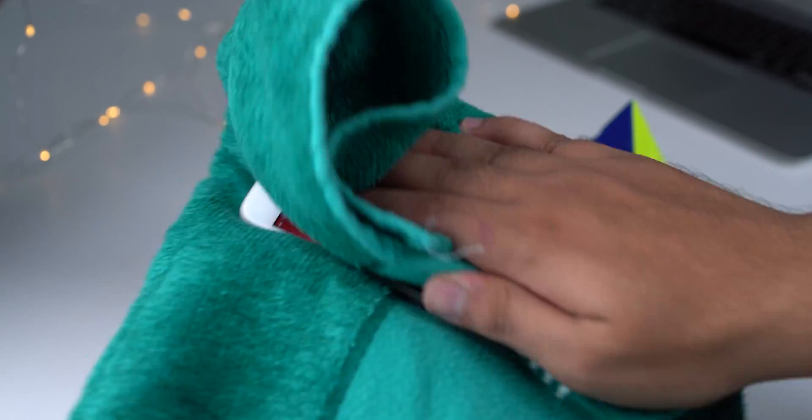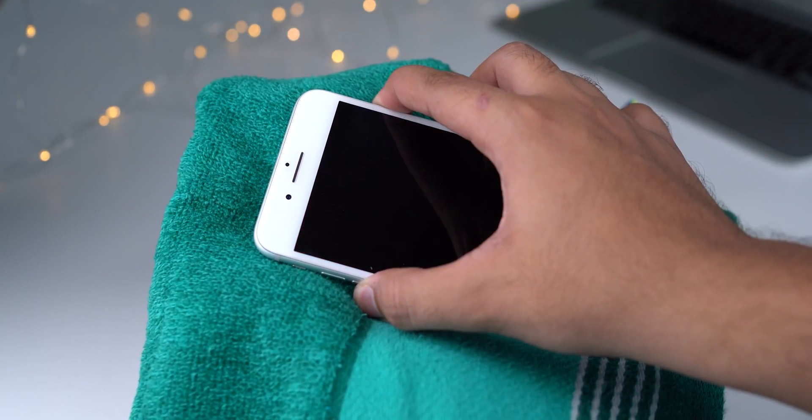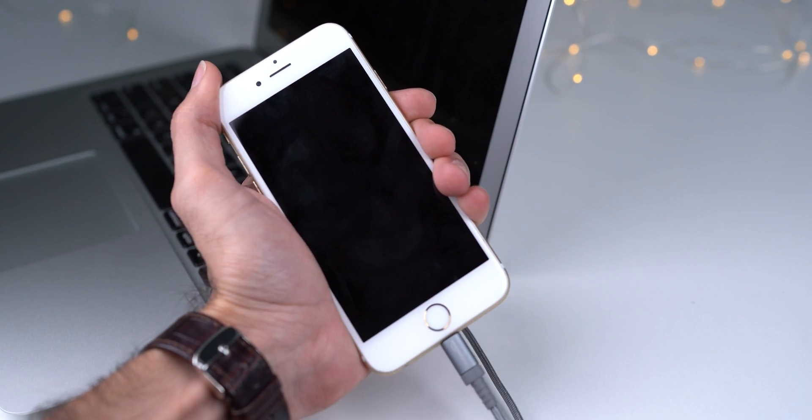Another very common reason for an iPhone getting frozen is water. We all know that iPhone 7 and later models are water resistant, but every device has a limit. If you believe your device was underwater for a longer period or under rain for an extended period, quickly dry it. Try to wipe off the touchscreen with a dry cloth. Even if it starts to become a little responsive, use it and turn off your iPhone, then switch it on when you believe it might be dry. Pro tip: never plug a wet iPhone or any device into a charger, computer, or any external power source. Another method that can unfreeze an unresponsive touchscreen is connecting it to a computer or a charger, but only if it's not wet.